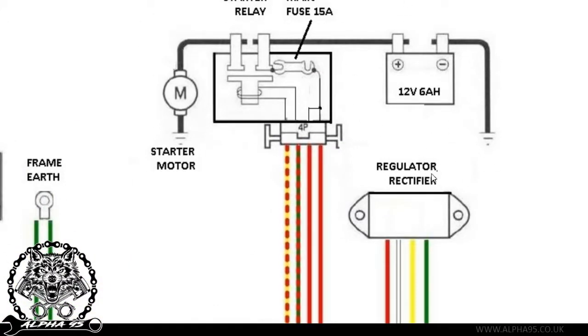So over here you've got your battery. This side here, which is your negative terminal, that is ground to the frame. This side over here is your positive terminal, so this is where your power goes out to your motorcycle. You might notice this over here — this is where the power also goes out to your starter motor. So when you push your start switch, this is where it connects and pushes power from the battery to spin your starter motor.